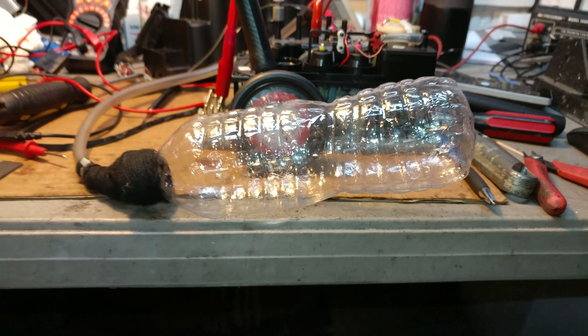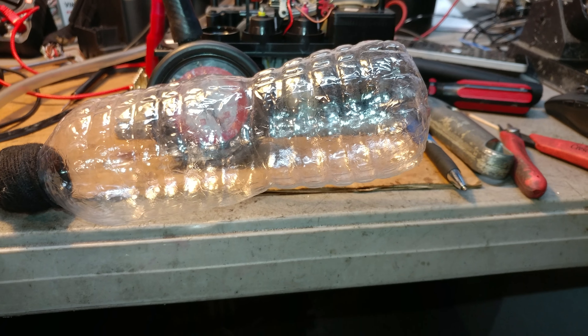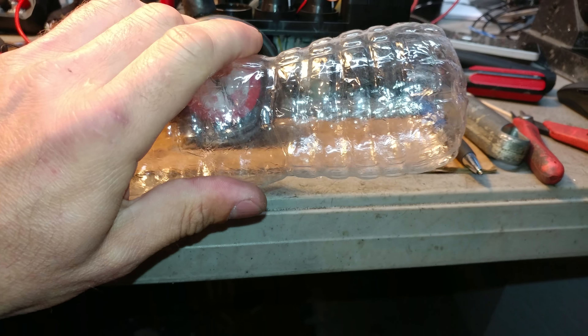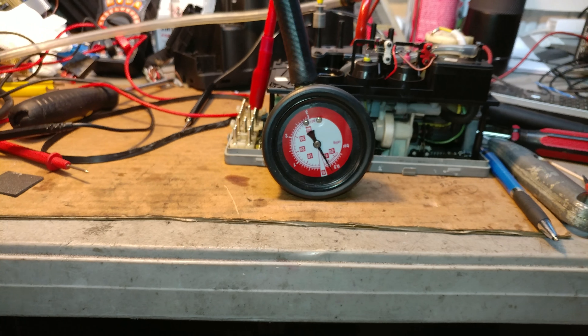The only problem is I think there's a leak in the seat somewhere, so it's going to continue reactivating the pump and that leak is going to burn the pump out. I wanted to shut the circuit down — I just wanted to show that it works. If need be it could be reactivated; there are no leaks in the pump itself, and that's what's important.